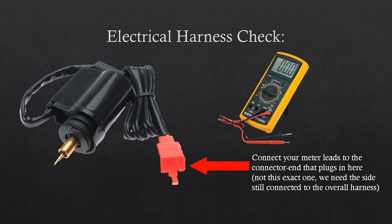If you have a voltmeter or multimeter, disconnect the choke harness and connect the two wires to your meter leads. Next, turn the engine on and you should get a reading of about 12 to 14 volts. On normal bikes this should be an AC voltage, since a lot of times the choke is actually wired into something like the lighting or accessory circuit. But depending on your bike or vehicle it could be running off DC power, since the choke will heat up with either AC or DC. So it's a good idea to go ahead and check both if you're not sure.